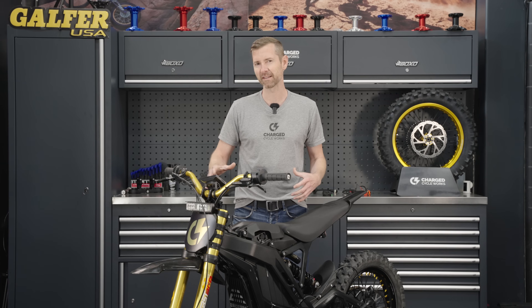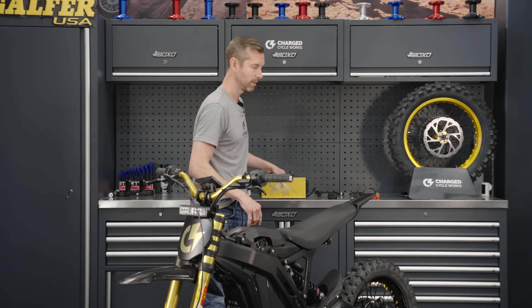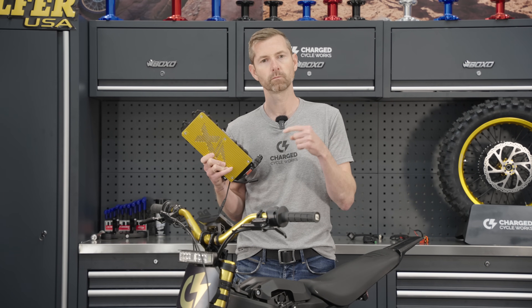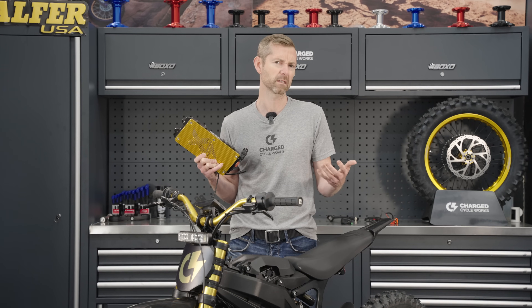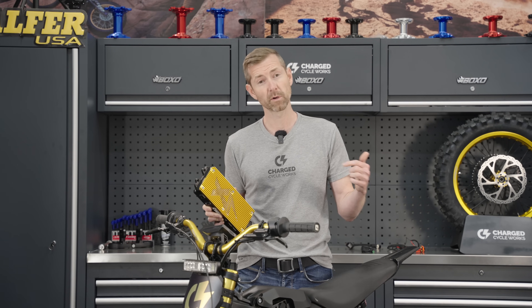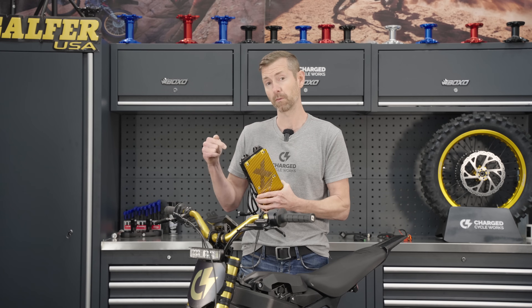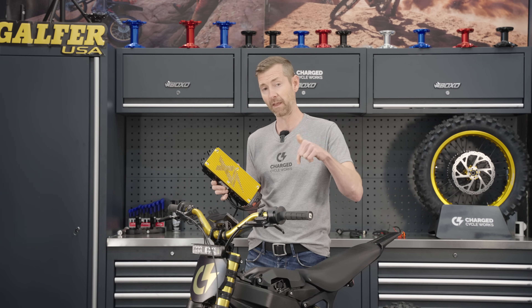Now we've got the bike set up in a really great spot. We could go out and enjoy this bike and make the most of it, but we're going to take it one step further by adding the EBMX X9000. The ways you can typically get more power out of a bike is a power controller like the X9000, adding a bigger or more powerful battery like our race battery, or a motor that can handle more heat and push higher RPMs. Because the E-Ride already has the 72-volt battery and it already has a QS motor, simply installing an X9000 is immediately going to take the power up to 15 kilowatts, getting 150 amps out of the battery, pushing 600 phase amps out of the motor itself. That's going to be a big increase.